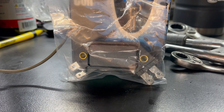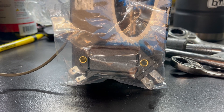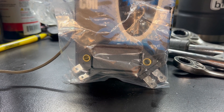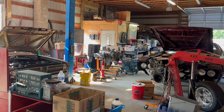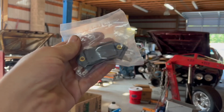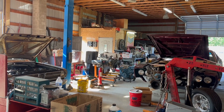So this seemed like a great option. The HEI module is kind of amazing. For one thing, it's incredibly versatile. You can trigger this thing with almost any distributor — that includes points. Obviously this is a Mopar-centric channel, but if you're having ignition problems on anything, you can retrofit this module in there to solve them.